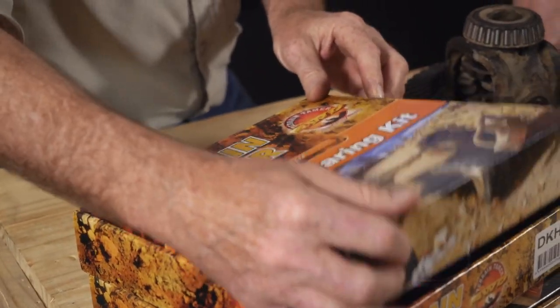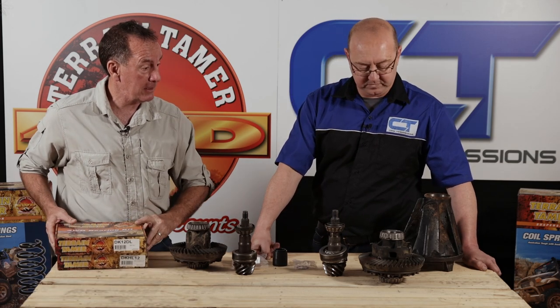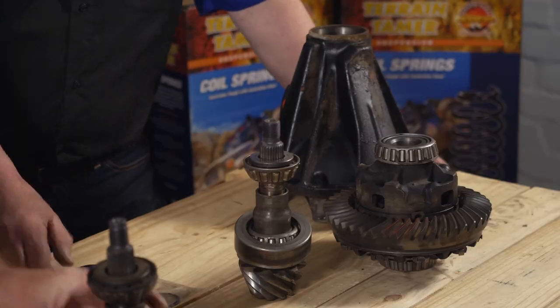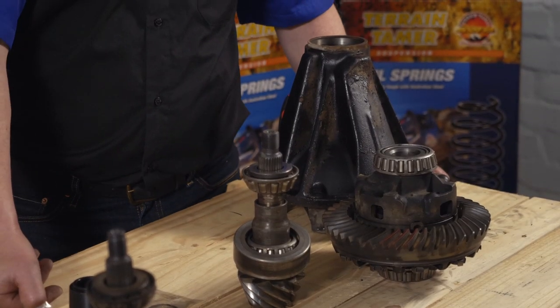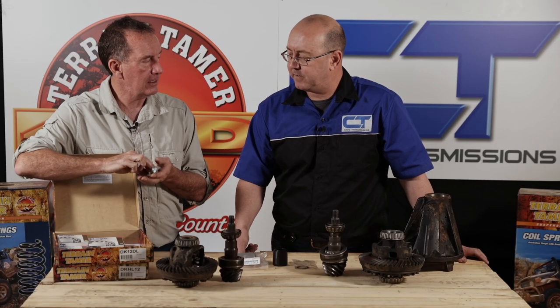It's a great kit that makes life easy. We've got another kit for the rear as well, which again will make life easy, and we'll fit the same solid spacer. We didn't find any real problems with the crown wheel and pinion there - all the hard parts check out just fine; they last a long time. The rear kit is similar - four bearings and again two different nut and seal sizes catered for, so it's a comprehensive kit that includes all the options.